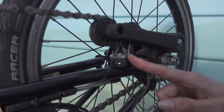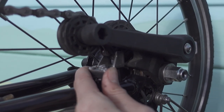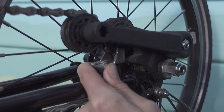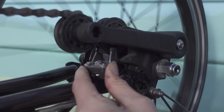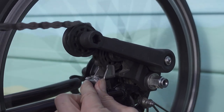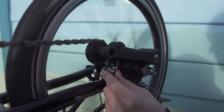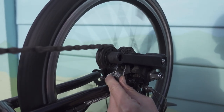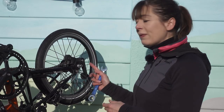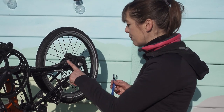This is the chain pusher, or effectively the derailleur on the Brompton. It twists to push the jockey wheels and change gear. However, despite having given my jockey wheels a nice overhaul and they're all nice and clean, they're not reliably changing gear. We've cleaned the chain tensioner and we don't think that's solved the problem, so now we're going to take it off again and take the chain pusher off as well.